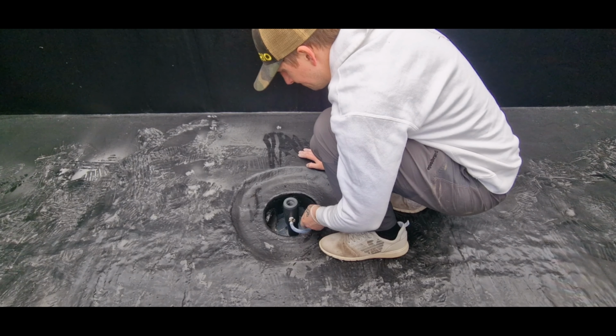I'll show you what I'm doing when I get to it. Cheers. So there we go. I'll try and show you the tiny, tiny little switch. That switch there. So for pump fed, it is one up, two, three, four down. And for gravity, it is one down, two up, three, four down. Simple. That's honestly how easy it is to change from gravity to pump. You just switch a switch and move the probes to the other side of the drum.